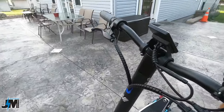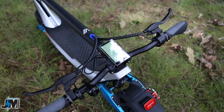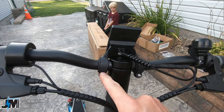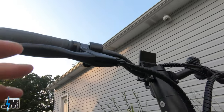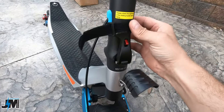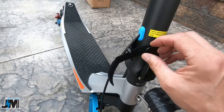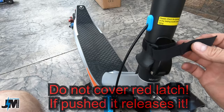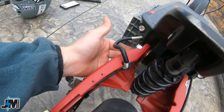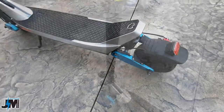The display doesn't tighten super tight but that's okay — it lets you move it when folding. If you need to adjust your throttle, there's a little set screw underneath, just loosen it, adjust, and tighten back up. There's also a velcro strap for added safety — make sure you undo it first so the red lever latches into the stem properly, then run the velcro strap around for added security. They also improved the motor wire routing — it comes up over top now instead of underneath like on the Eagle One.